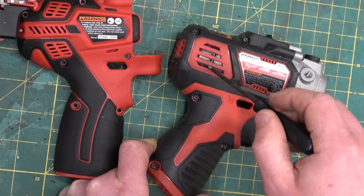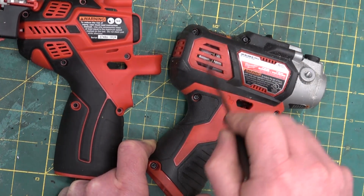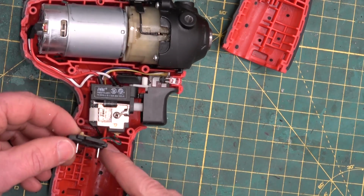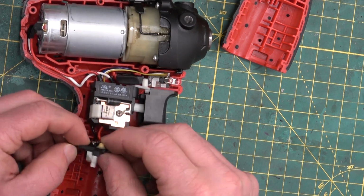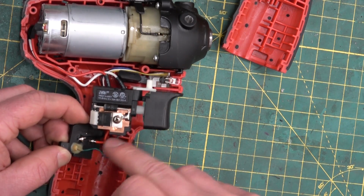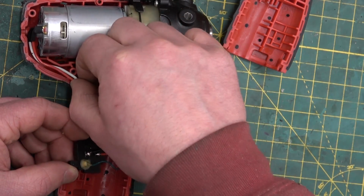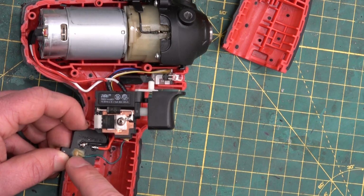You know, some tools you see, especially older ones, where these little slats are real long and thin and they break out. And the battery terminal is on its own molded part. Terminals themselves nickel plated, copper more than likely. Yeah, it'd have to be copper, and then looks like some solid wires, little tiny wires. They aren't solid, but they are stranded, and good soldering.